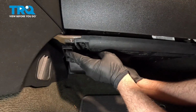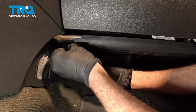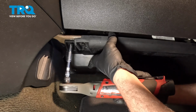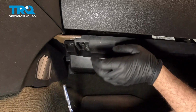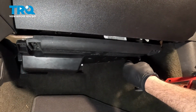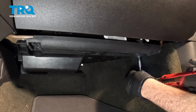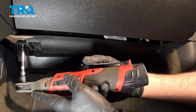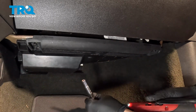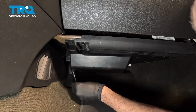Now once you have that back corner post up into place, we're going to line up the front panel here. Not going to tighten that, we just want to get that cut, and then we'll go ahead and get the screw installed on the other side. And we'll run that one all the way up, tighten that one, we'll do the same here. Now we'll go ahead and get that screw in the back corner. Take your third screw, gonna feed that up inside.